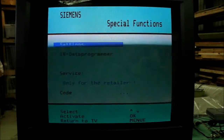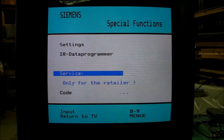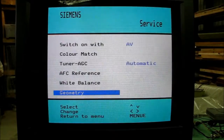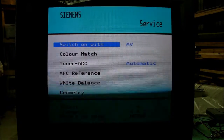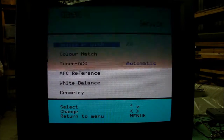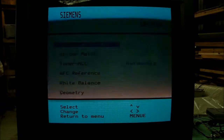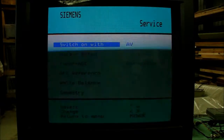What I do like is the ability to get into the service menu. It's got the gateway to it here — you just have to enter the right code, and the code is 089, and then you're in. You can go into your geometry and adjust all those things. Another nice little feature, particularly if you're into the arcade scene and you want to put a tube like this inside an arcade machine — though at 76cm it's probably too big for that — is that you can set it so when the TV first turns on it'll be on AV, like SCART-1 RGB, rather than your regular RF channels. For an arcade cabinet that's really good, because you're not going to need to use your remote to change your channel every time — it's going to be on SCART-1 RGB straight away.